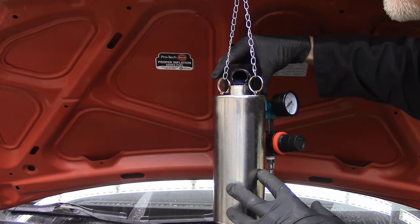One of the things that can help you decide whether you should clean your injectors or not is to look at the long-term fuel trim. Long-term fuel trim down here at the bottom is kind of what the computer's been doing to correct the fuel system over the long haul. And in this case, it's been adding about 4.7% fuel since I last reconnected the battery. So it's been adding some fuel.